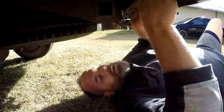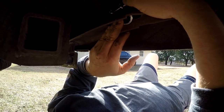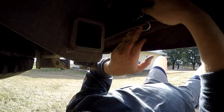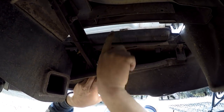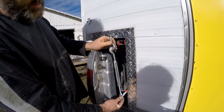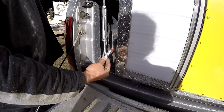I'll take this shackle and go through these two holes. I'm gonna attach the cable to here and it's gonna go up and connect to an eye bolt on the camper, through the crack between the bumper and the tailgate. So the eye bolt will be in here, then the turnbuckle, and then hook to the frame down there with the cables.